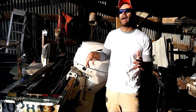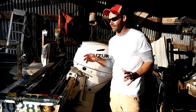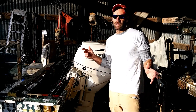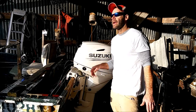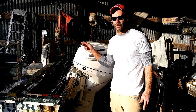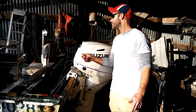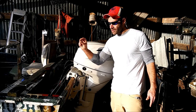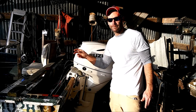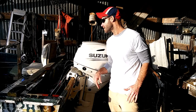After the first 20 hours of break-in period, the remote will start beeping intermittently. You'll likely be out on the water when you hit 20 hours. If you start hearing it beep, you need to take it in for an oil change. To stop the beeping while you're out on the water, pull the emergency red thing out, then pull it out and let go of it three times and it'll stop beeping. Make sure you get the engine in to the dealer for an oil change.